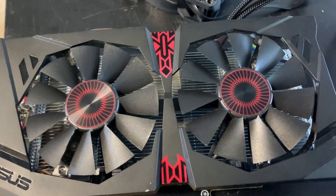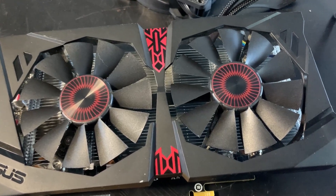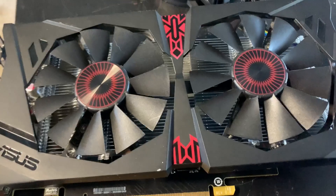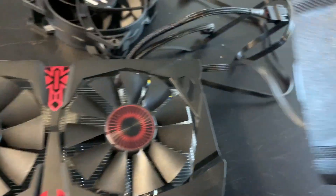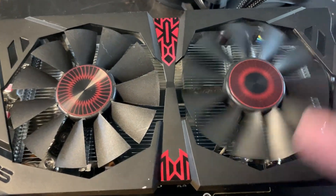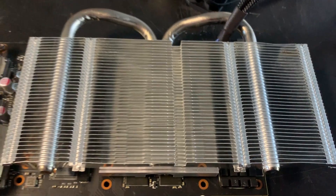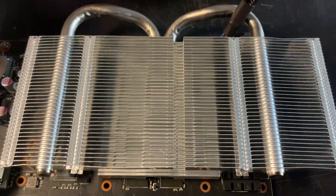The results are in. I did some testing and benchmarking — good news and bad news. The good news is that it works; the heat sink is awesome and there was an immediate temperature difference. The problem is — and I knew this coming in — the single fan board cannot control two fans. I tried putting in two Be Quiet fans with the double header and it won't boot. I was hoping these smaller fans wouldn't draw too much power and it would work, but it doesn't boot with two fans connected.